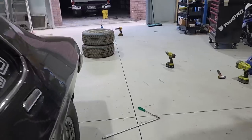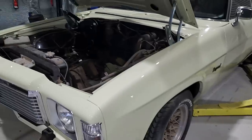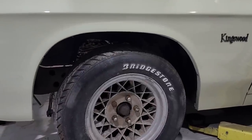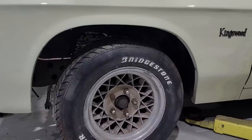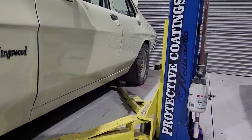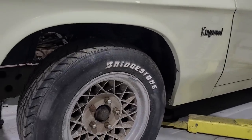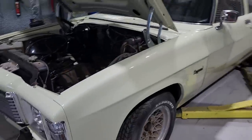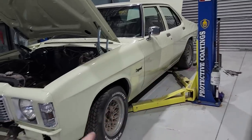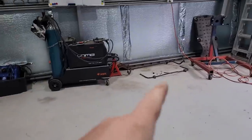It's a little bit lower than what I wanted it to be, so it's not looking perfect, because by the time the motor and the Turbo 400 goes in there that's going to come down a lot. Once there's a full tank of fuel that's maybe an extra 60 kilos. I suppose I'll just have to wait and see once the motor and box goes in — hopefully it'll be the same height; if not I'll have to either lower the back more or change the front springs.